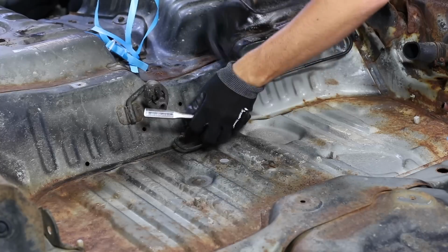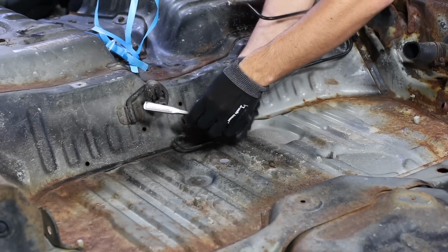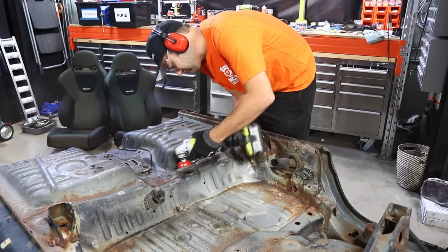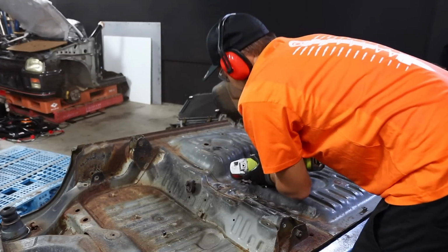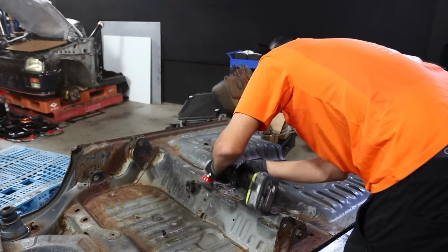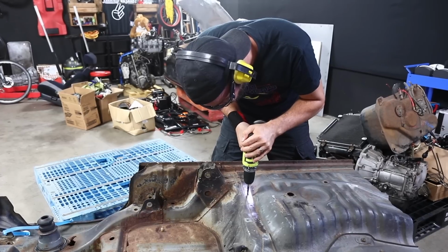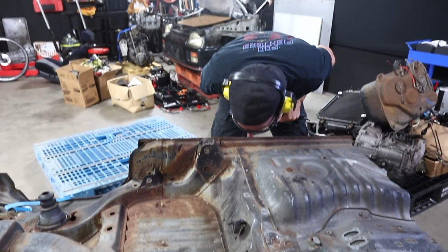Let's do it. We haven't done this before, ever, and it all working out relies on the fact the factory is going to have to do the bare minimum necessary to accommodate the different drive lines. In this case, that means the car should be identical from the rear seats forward. If that is the case, there'll be reference points where both floors are the same and we can stitch them back together.